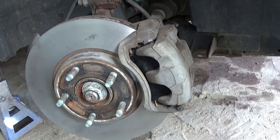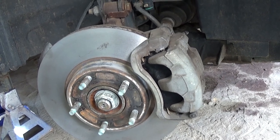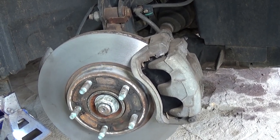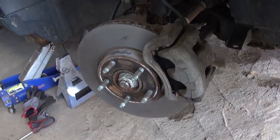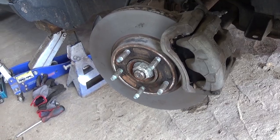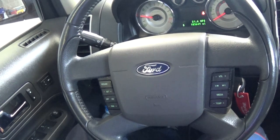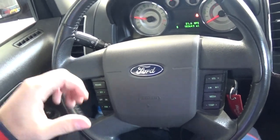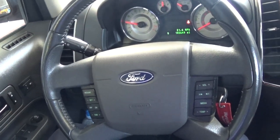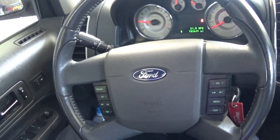We are inside now with a person pumping the brake pedal. I can see a little bit of movement and we don't have any more play. After driving the car on the highway, there was absolutely zero vibration at highway speed — I even went to 75 to 80 miles per hour, hit the brake, and there was absolutely no vibration or pulsation in the steering wheel. Hopefully the video will be helpful to some of you to fix that problem. Thank you for watching, and see you guys next time.